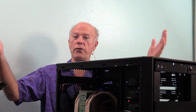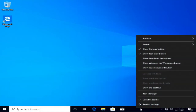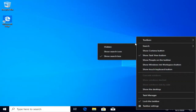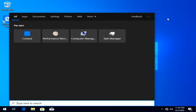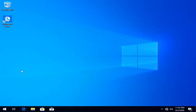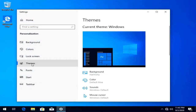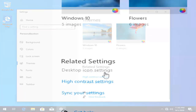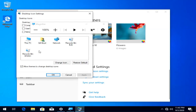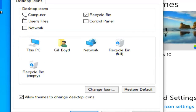The next thing I like to do is customize a few things. I don't want to see the search - that's the first thing I'll do. Do not show me the Cortana button, do not show me search, because I have Windows Flag S to bring up search. I'm going to right-click, go to themes, scroll down to desktop icon settings. This will allow me to put the icons I like on the desktop - the computer, user files, network, and control panel.